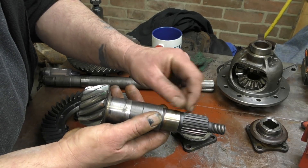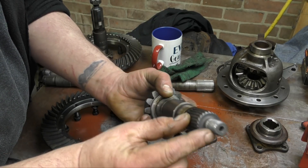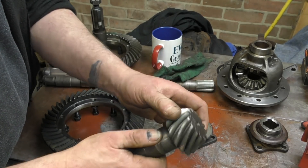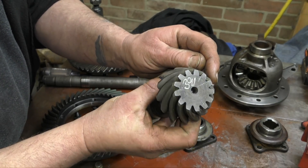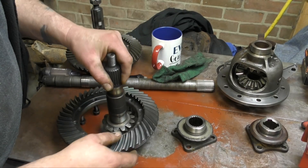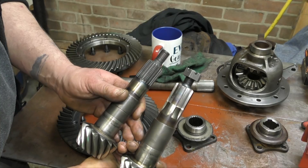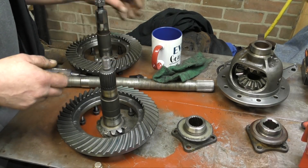You want your flange to be tight on there — don't forget there's a lot of torque going through this. Just visually check and make sure that it's not unusually damaged. These actually do last a long time. We will have to talk about the difference in pinion heights, because there are three different types, and that'll be in the next video. Pinions come in all sorts of different configurations, and it's mainly how you bolt the flange on.